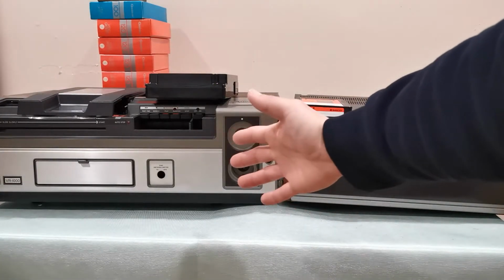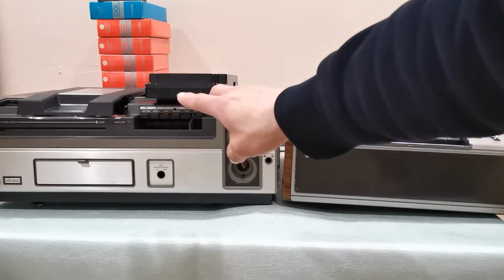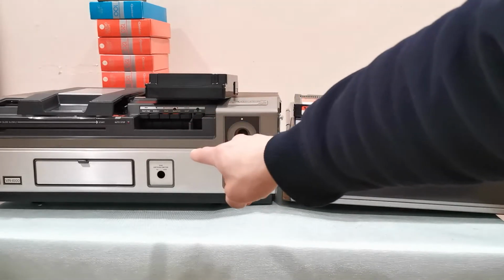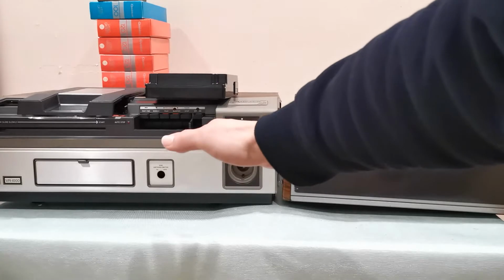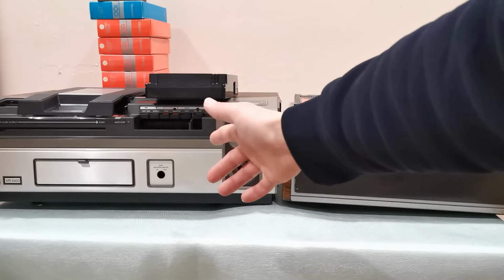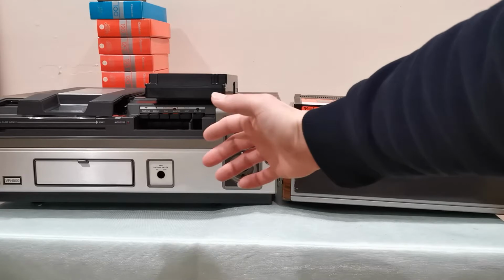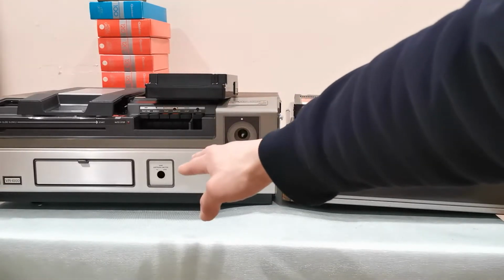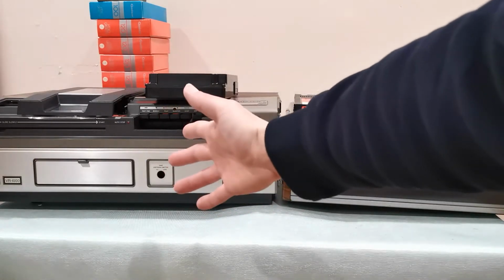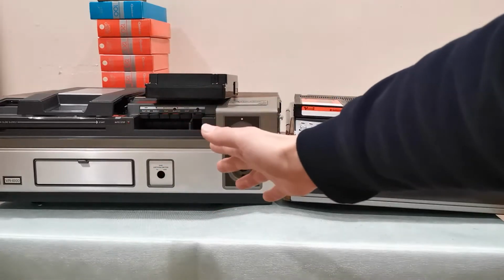Now, maybe you work transferring old videos into a digital format. So I'm going to tell you, I recommend you clean those machines at least every 2 hours. I mean, you can go ahead and clean them more often. For example, if you're transferring a tape of a television program and it does have commercials, you can go ahead and stop that machine as soon as the commercial starts, and you can go ahead and clean the heads. I mean, if you want to, I recommend at least 2 hours, but if you want to, you can clean them more often than that.